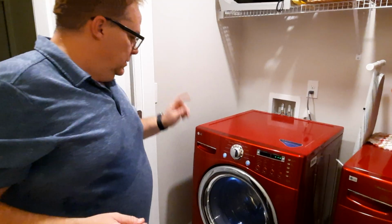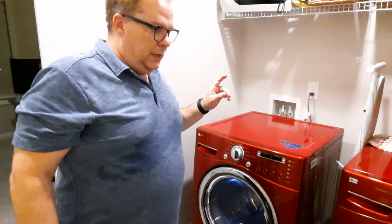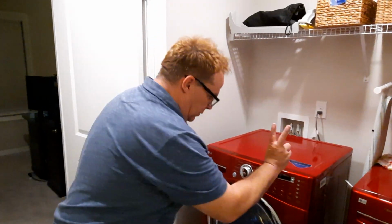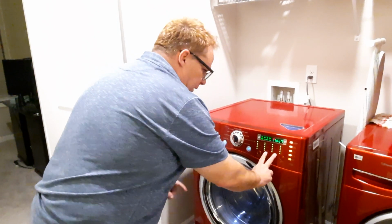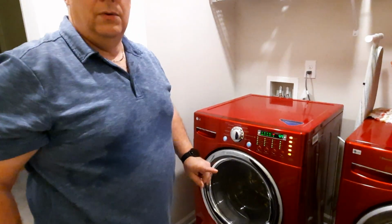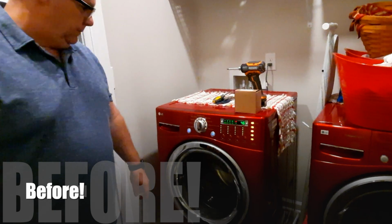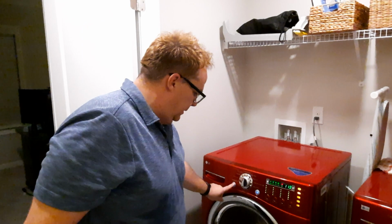It turns on. So what we're going to do is turn it back off. I'm going to go back into diagnosis mode, which means it'll turn on the pump and spin the motor for me. So once again, if you remember, spin, speed, and soil level, press them together. Holding, press the power button. See a bunch of dancing disco lighty thingies going over here, and then you press the button one time. That's what I want to hear. No more grinding. Oh, now we're going to go into fast mode. Perfect.